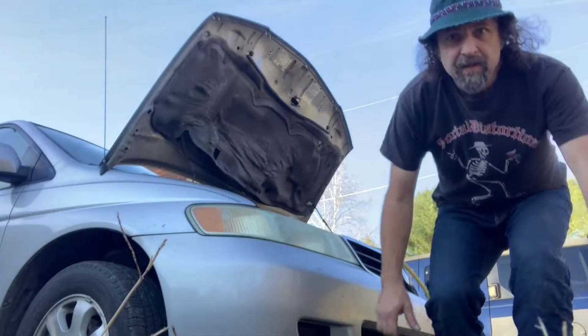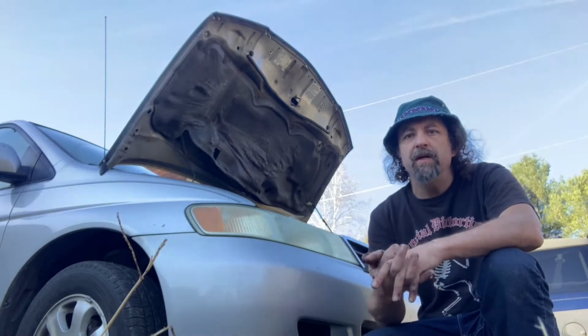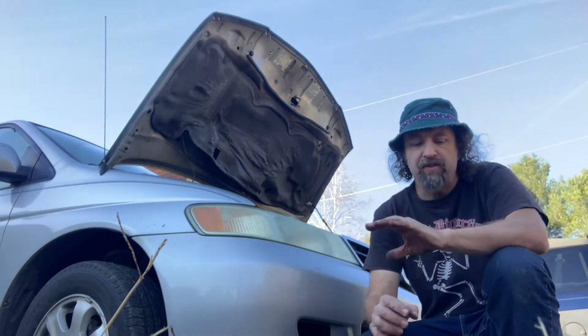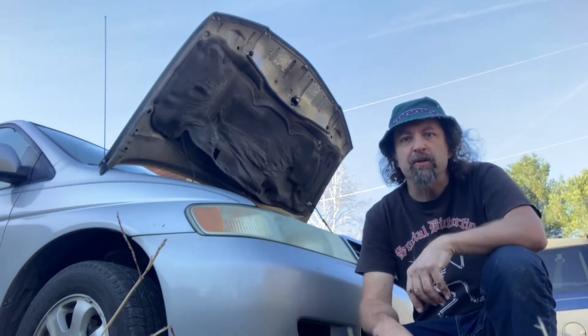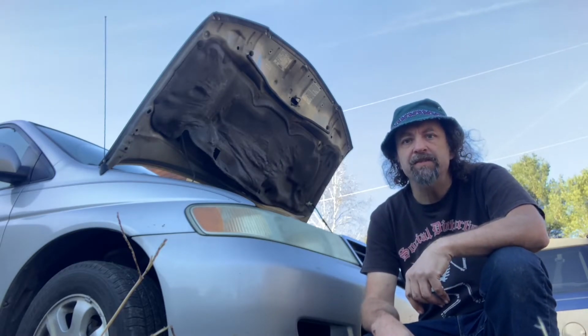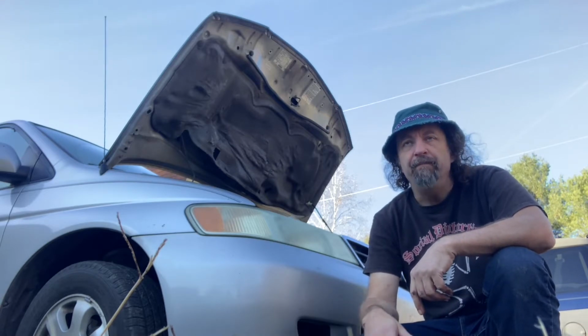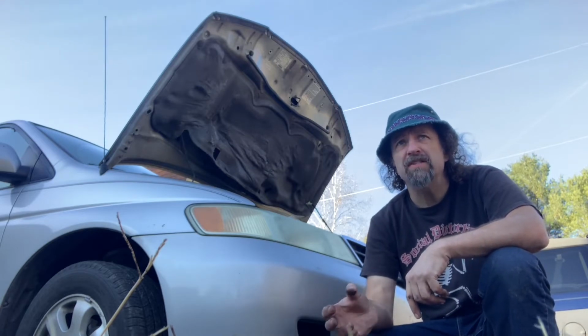So I just finished doing all that cool work with the lift and the suspension and everything on the back of the Odyssey, and of course it immediately develops a severe misfire. Typically with these old 3 billion mile Hondas, I've learned to replace whichever coil pack. If it's a hard miss on a particular cylinder, I replace that coil pack. That didn't fix it, so I pulled the spark plug. That didn't look bad. Checked the valves, they were adjusted a little tight.